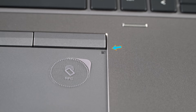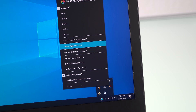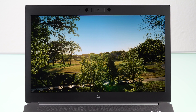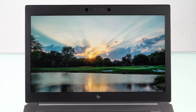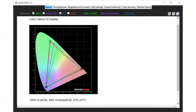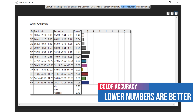The profiles include Adobe RGB, sRGB, DCI-P3 — you get the idea. They did a pretty good job, though sometimes the gamut suffers a little, getting narrowed in the interest of color accuracy. Overall they did a good job. For our gamut tests I ran it at the Adobe RGB preset before testing. There's also a Full HD display at about 95% of sRGB for those not doing color-critical content, and a 4K touchscreen option listed — also 95% sRGB — though I didn't see a way to order that.